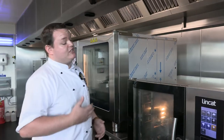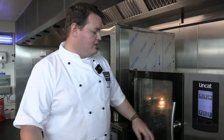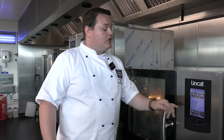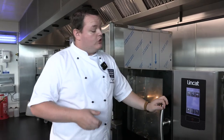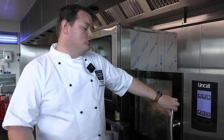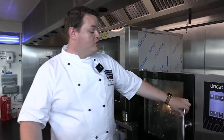You've got recipes and a Smart Chef feature where you tell it what you want to cook — say beef, grilled — and how you want it cooked, and the software determines the best settings to accomplish that cooking. You can create your own things and store them in recipes or favourites. Standard combi features include USB control for uploading recipes across multiple ovens on an estate without manually programming each one, plus HACCP data recording temperature and time — useful when the EHO inspector visits.